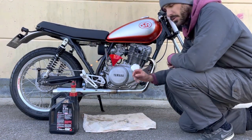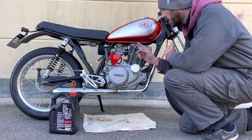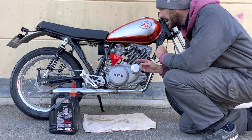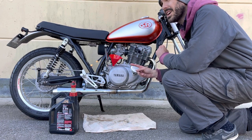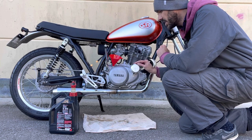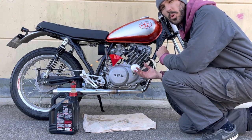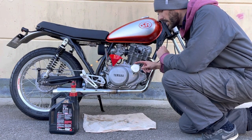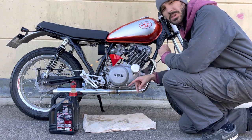And the final step, now that we've got the sump plug back into place and torqued up to specification, it's time to fill up with oil. It's a boring process, it's pretty straightforward, so I won't film that. But there's two different values they give in the manual. One is a volume without a filter change, and the other one is with a filter change. With the filter change, there's obviously slightly more oil. And then also, if you actually have the Jadus oil cooler cover, you'll need even more oil. But I'll list those in the description.